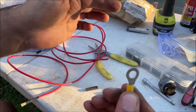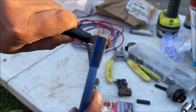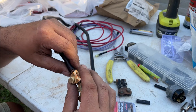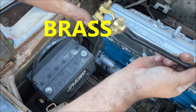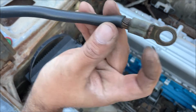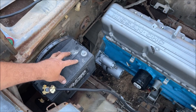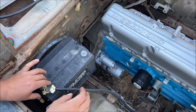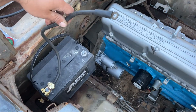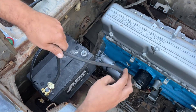This side's going to the starter, so make sure the hole's big enough for the starter stud. These were all mangled — I cut them down and cleaned the wire really good. The gold ones are kind of a pain to squish down for the negative terminal, but they look good. These appear to be the factory cables; inspect the crimp — everything looks good on both. The bigger hole is our ground to the engine block. This is not the right battery for this car, so I'm going to route this cable where it can't touch anything.